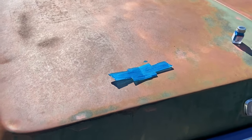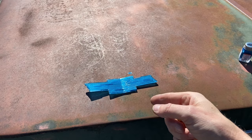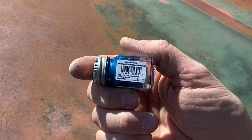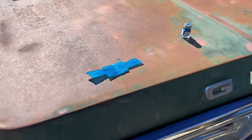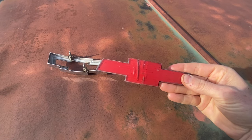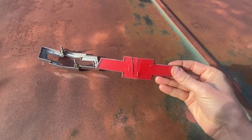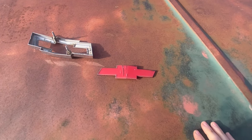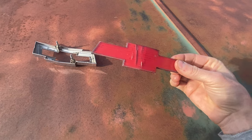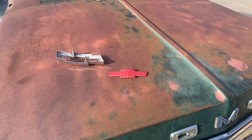So we've got the first thin coat on and that metallic looks awesome. I think I forgot to mention — we're painting the back side of the bow tie, not the front. Three thin coats on the back. This is the Testers Blue Metallic Flake. We'll let this dry for a couple hours and come back with coat number two. One thing I forgot to address is what happens if your inner bow tie is severely cracked or damaged. Well, you can go through and try to glue it back together and paint the front side of it. Or — I saw a guy named Greg out of the Oklahoma C-10 Club who had his 71-72 bow tie painted bright red, but he'd actually got a piece of vinyl, cut it out, and stuck it on there, and it looks sweet.